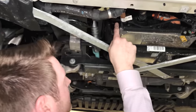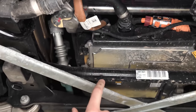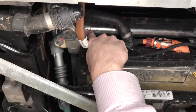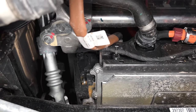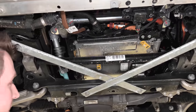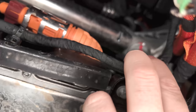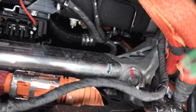There's something pretty cool here I don't think I've seen before. Similar strategy — steel lower cradle, which makes sense especially in the front, similar to what we saw on the Mach-E, and then an aluminum motor slash PDC mount up top. This piece is pretty shiny — we didn't get a magnet on it, so we're not sure if it's aluminum or stainless steel. You can see it's not welded and there's a relief here — these might be bonded in place. And there it is — that's glue coming out. Both front and rear are sleeved and glued, not welded. The dual durometer mounts are sitting in a polymer housing, which also helps with tunability.